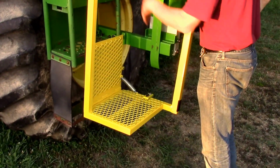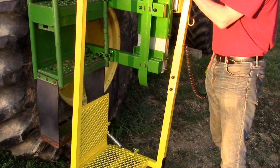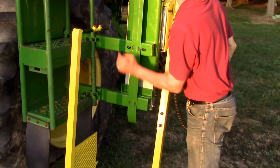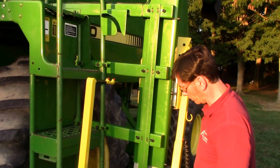And again, the purpose here is, you can get some wear in the trolley and things like that, but you want to make sure that when it gets to the upper level, everything's lined up properly so that this pin right here is going to slide right into that track and cause the bridge plate to operate normally.